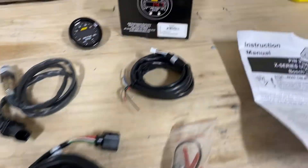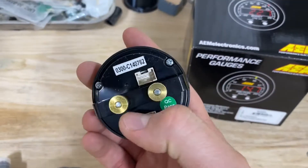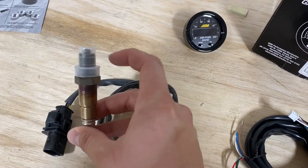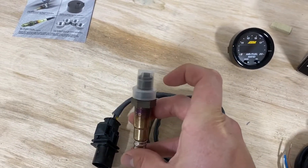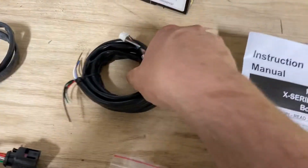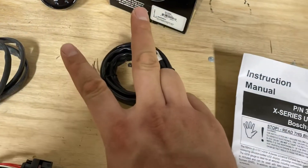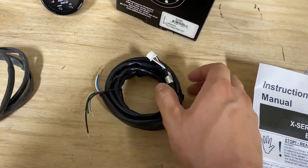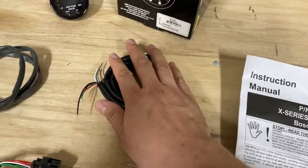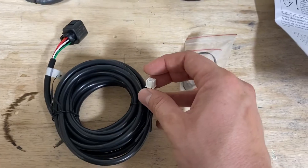Let's go ahead and unbox this AEM. Opening up the box, this is what it comes with. Obviously you get the gauge itself — very basic, with two electrical connections in the back. You get the wideband sensor — be careful, leave the cap on, you really don't want to be touching it or getting oils from your hands on it. Keep it covered until you're ready to install. You've got the wiring here, which is your power wiring. You only need to use two of those wires — the rest are optional. For most people you're just going to use a 12 volt source and a ground. If you can wire an electric choke, you can wire one of these up. This is all plug and play.